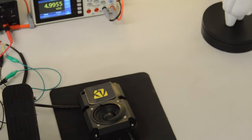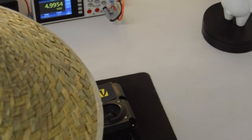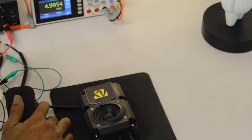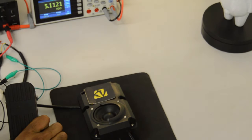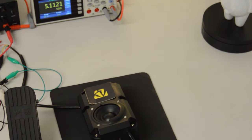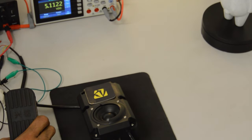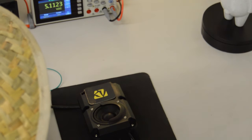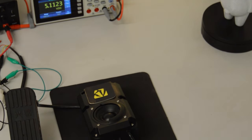Change sound — another sports bike-y one I think. Doesn't seem to rev as high as I'd like. Maybe a tiny little bit more voltage on the throttle there. So doesn't seem to rev as high as what I'd like — that's my first observation. I think there's a calibration to set your max throttle voltage. We're not going to do that now, but I think you can probably adjust that so it does rev a bit higher. That's funny, I like that. This is actually funny.